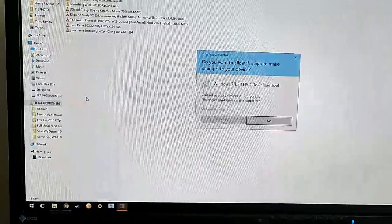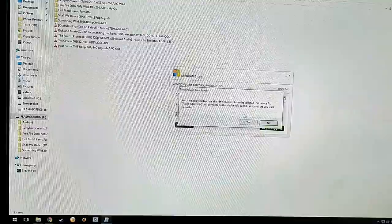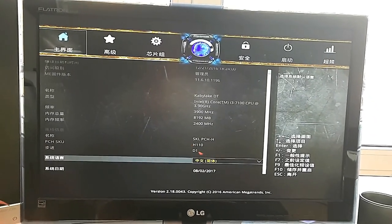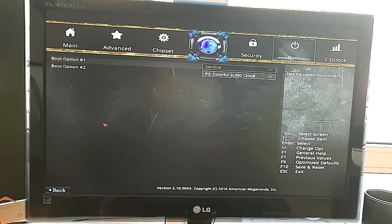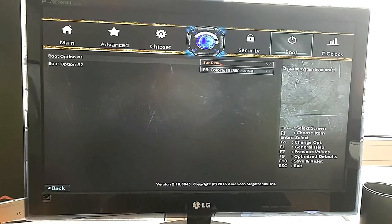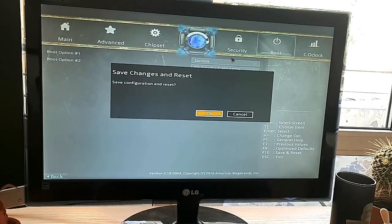I know it's a bit of a chore to install a new Windows and some of you don't know how to do it, but if you follow my lead it's super simple and very easy. All you need is a flash drive and the Windows 7 USB DVD tool program — I'll leave a download link. Load your copy of Windows on it, format the flash drive, and install it via the BIOS. Set it up to boot from your flash drive; press DEL to enter the BIOS, restart, and it will automatically load Windows from the flash drive.